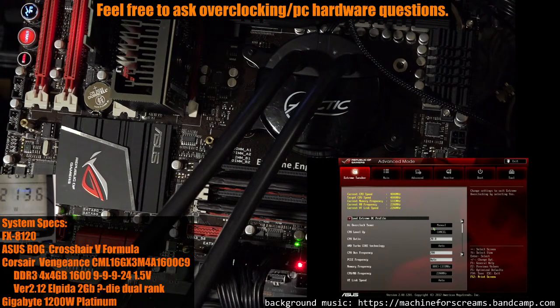At what voltage is it possible that the RAM is degrading for DDR5? I don't know. I haven't heard of anybody managing to degrade any Hynix DDR5 yet, and some people have run very high voltages. I've run some very high voltages, and none of my sticks seem to be affected at all. So at least the Hynix memory chips seem to not really care.